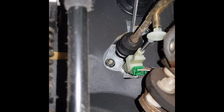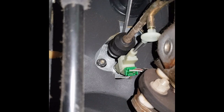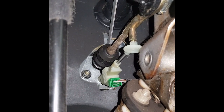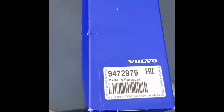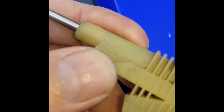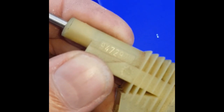As you can see, that's all there is to it. I believe these are the same for — this is a C70 — and the part number on this I'll give you in a second. Put this part number into places like eBay, and if it says it's not compatible with your C70, well, it is. It's also compatible with V50s, V70s — in fact, most of the Volvo range I think. Obviously it's worth checking before you do it yourself. The part number is 9472979. It's definitely the right part, so don't worry about ordering it and then having it not fit.